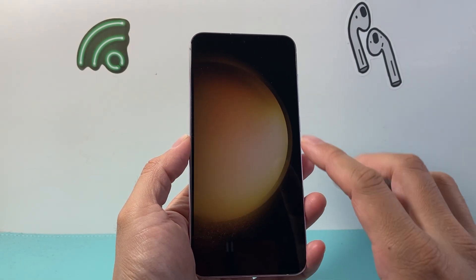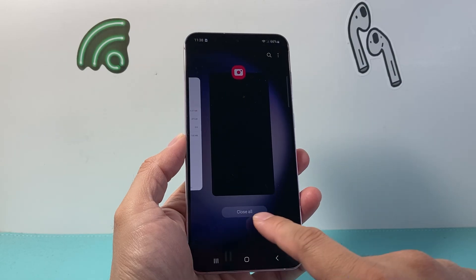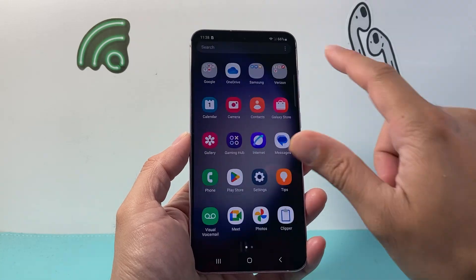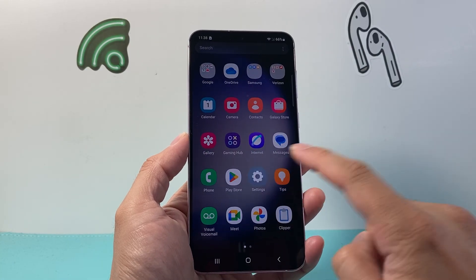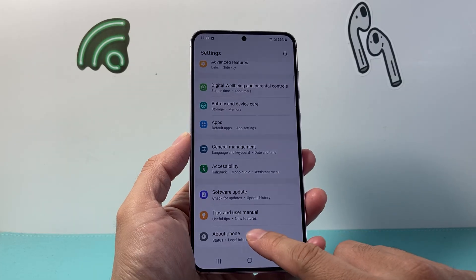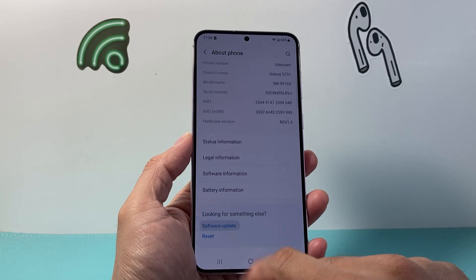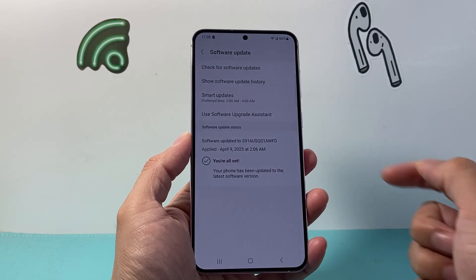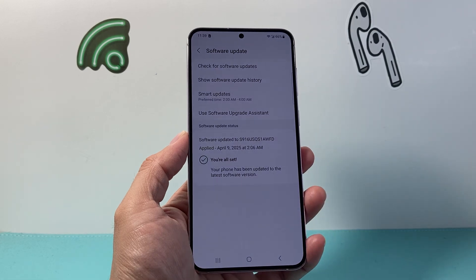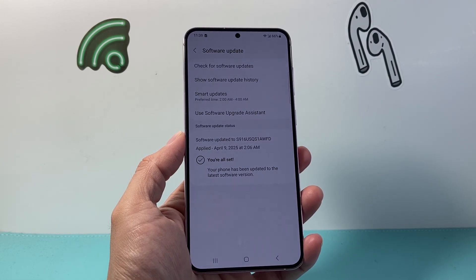If it's a specific app where your camera isn't working, I recommend clicking that option and closing out all the apps again, as sometimes that could be the issue. After you have done that and it's still not working, let's go back into settings. We're going to see if there's a software update — go into About and then look for software update. If there is an update, go ahead and update your phone, as sometimes that could be causing issues as well.